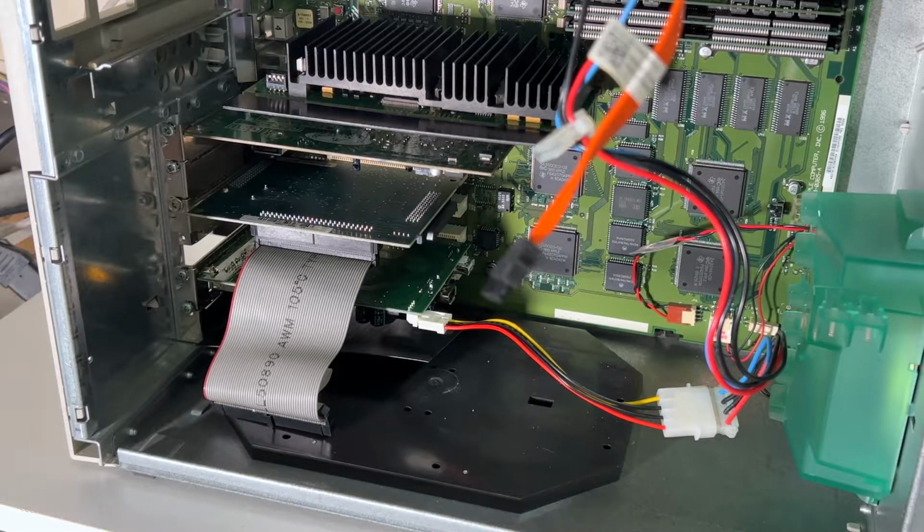Up above that, we have another USB and FireWire card. Now, unfortunately, the FireWire doesn't really work, because in this old Mac, on classic Mac OS, the FireWire portion isn't really recognized, which is kind of unfortunate, but what can you do? The USB part does actually work very well, and despite it being USB 1.1, well, I think it's actually a USB 2.0 card, but in classic Mac OS, it's scaled down to 1.1. It pulls some pretty respectable speeds even then, and it's much faster than the Opti FireLink card. I may actually get rid of the FireLink card, because 4 USB ports, 3 on the outside and 1 internal, is more than good enough for this machine, I feel.